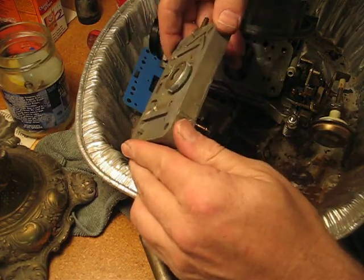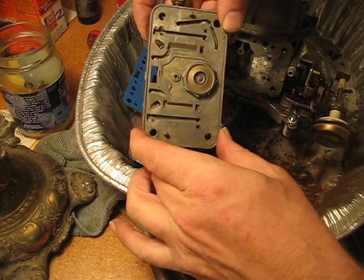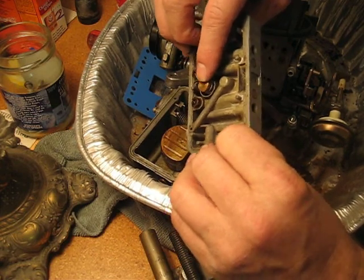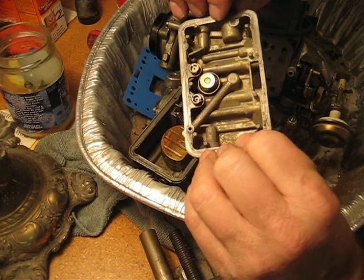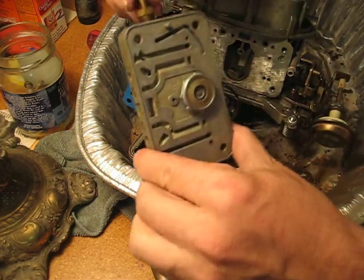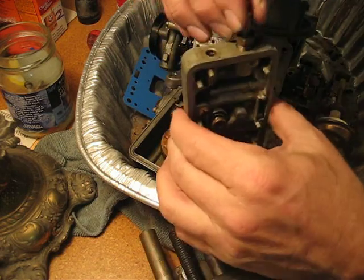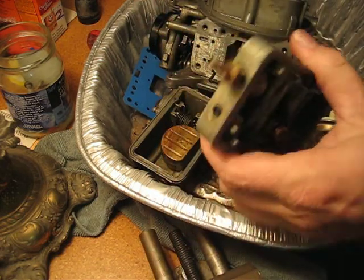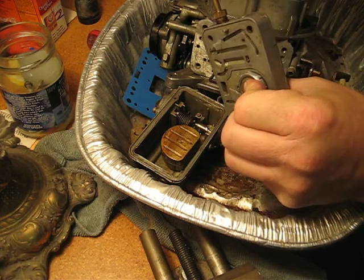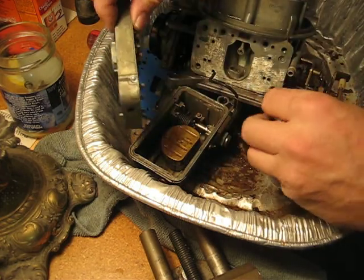I hope that's visually clear. It does have good action. And that's the condition of the metering block — the diaphragm vacuum is also clear when it goes to the distributor. So there's just nothing wrong with this metering block. It's very clean.